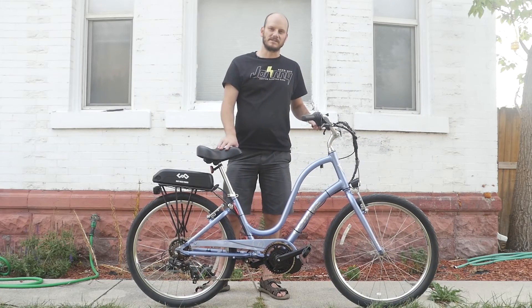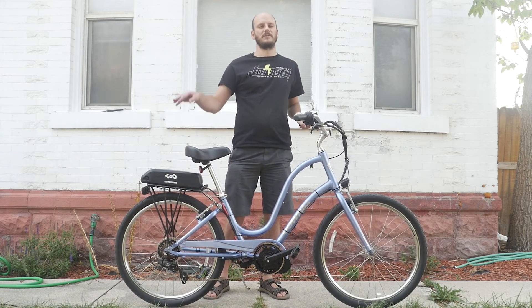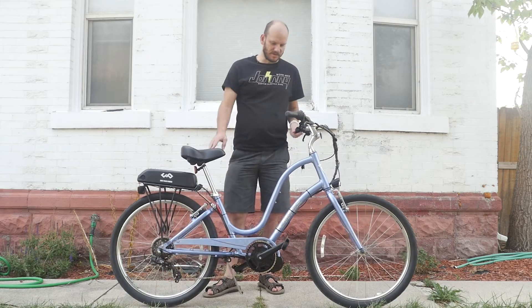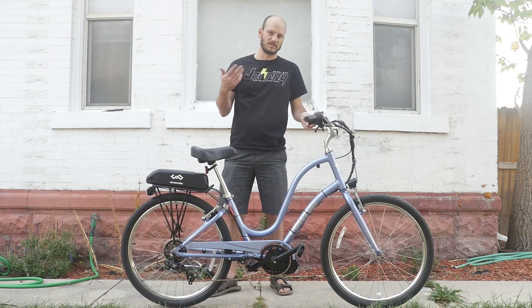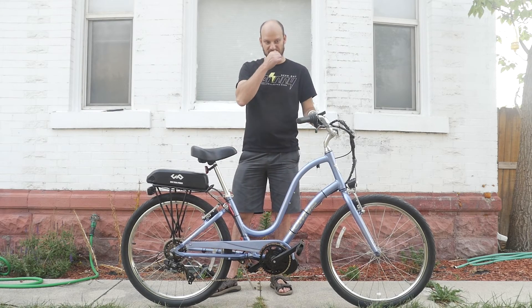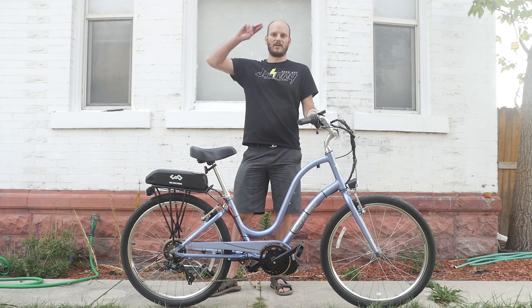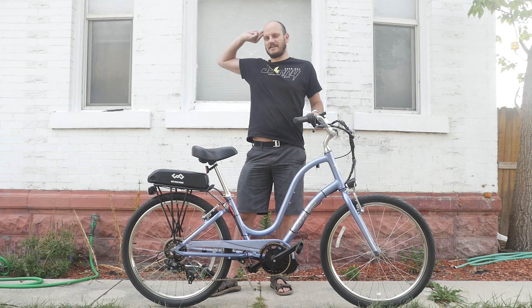You can see 32 miles an hour isn't crazy, but that's plenty fast on a bicycle — it's because this is only 48 volts. If you put a 52-volt battery on it, you'd probably get another two or three miles per hour. For most people, 32 miles an hour is already crazy fast for a bicycle. This build was about $1,150, including the rack and lights, minus my labor which is $320. If you have a bike like this already, you could do it yourself for $1,150 and get this exact setup with 40-mile range. Hopefully this helps somebody thinking about converting this type of bike. See you next time!